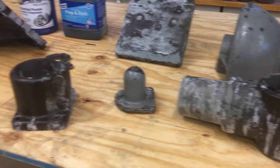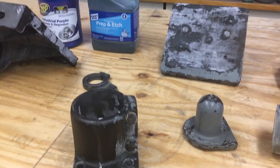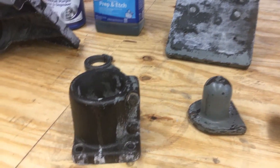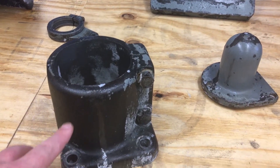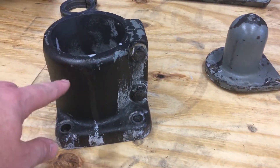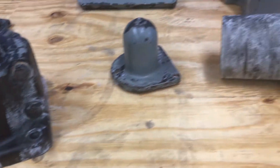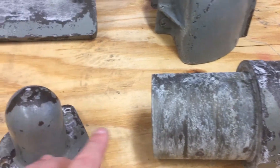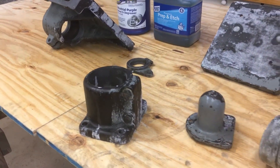That will cause it to flash rust almost immediately. If there's not already rust underneath it, I use the prep and etch. It's got a phosphoric acid that will take the rust and do a chemical reaction. I put this iron oxide into something else, but basically the black part is the iron oxide and the white part is just the residue. All of this will be media blasted, so all that comes off.